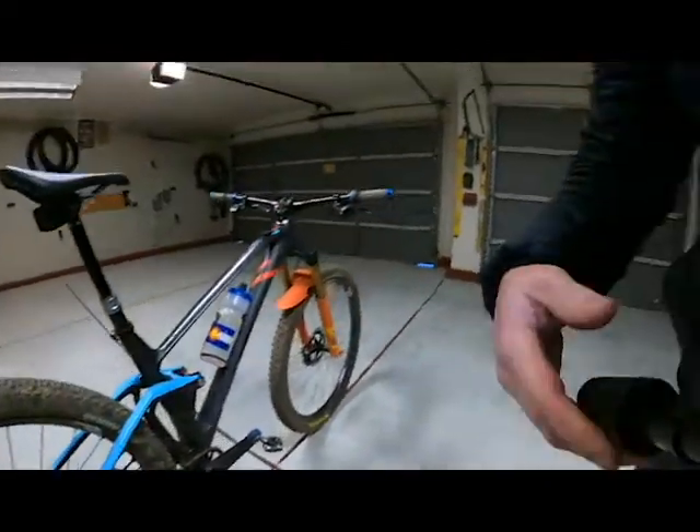I'm running the X01 because it's the lightest cassette. This bike was a lot about weight — I might have been able to run Eagle Gold, but it weighs a little bit more, so I made that choice because this bike was designed around weight. This bike just smashes downhill for what it is. It's got a pretty slack head angle for a cross-country bike — with the 120mm fork I've got on it, I'm at 66.2 or 66.5 degrees. For a cross-country bike, it's got a nice slack front end.